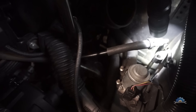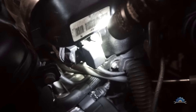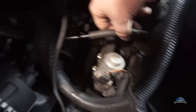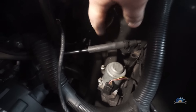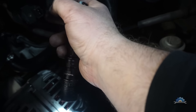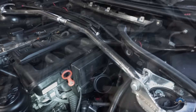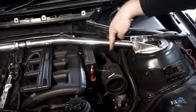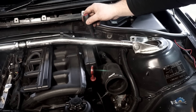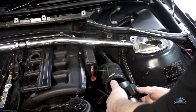This is the evaporation system from the fuel tank. This valve controls the amount of vapors going to the intake system, so if you're doing something around that area make sure it's connected and there are no cracks. I'll be covering that valve in my video about engine problems as well. Same reminder: this jubilee clip connecting both elbows — leave it facing up, so in the future it will save you some time.